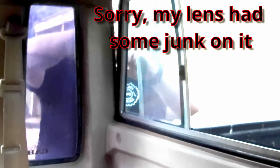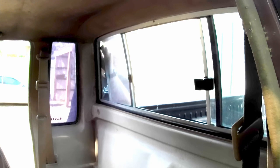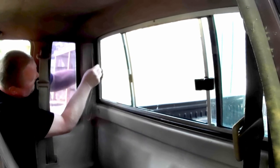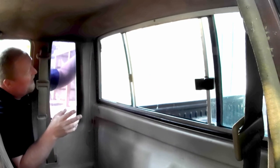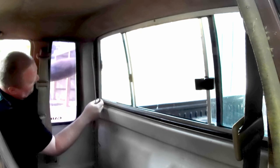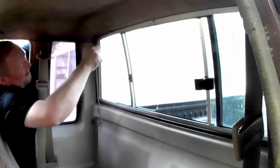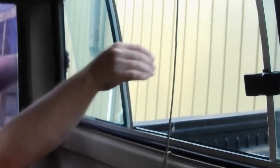I'm going to take both ends of our rope and just kind of lay them through here on this side. Make sure that we pull down on it as much as we can. Then we basically start pulling this rope through — I'll pull some on this side down here. The bottom's in. Some soapy water will help out if you find yourself having issues, but this one's going pretty good so far. From the back I'm just going to kind of push it, giving it every chance to go in. Occasionally I'll just take an opportunity to pull the window and make sure it's seated firmly.